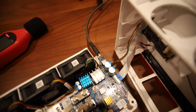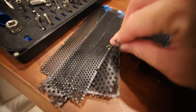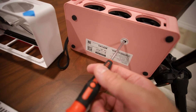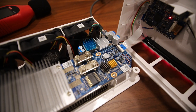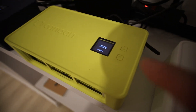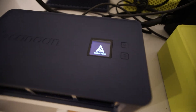To recap: five screws to open it up, and be mindful of the USB-C connector lodged in the housing when pulling it apart. I also removed the mesh grille from the front using a screwdriver — the LTT screwdriver and iFixit kit weren't long enough to reach under the Nano 3, so just be aware of that. Let me know what you think of the results. I'll see you all in the next video — hope this helps, have a good one!